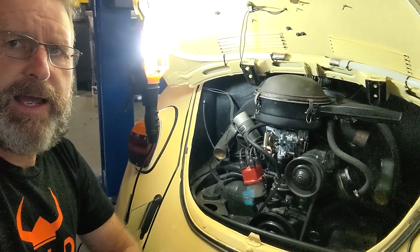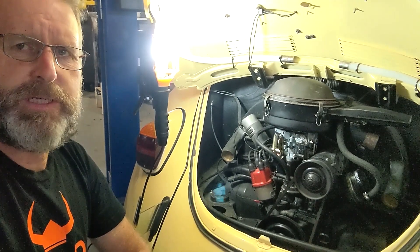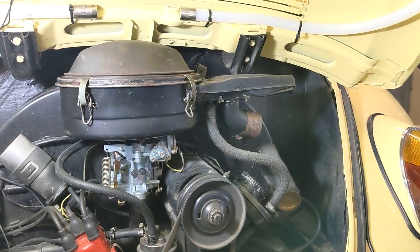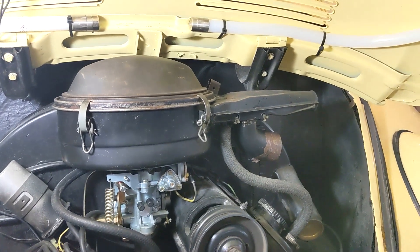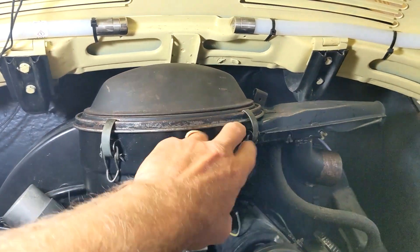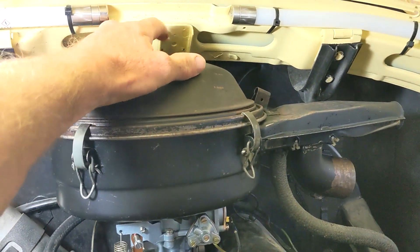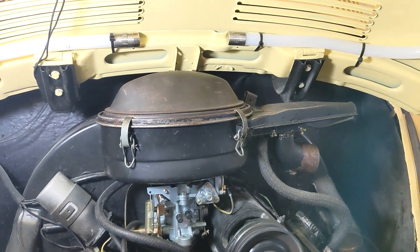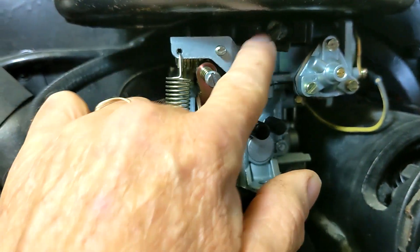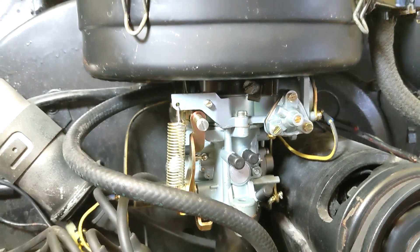It's an exact replacement for the original carby. So I'll put the oil-filled filter back on and talk a little bit about that filter design and why I've gone back to it. This filter is actually an oil-filled filter. Originally I tried just taking the top off and I couldn't do that — getting to those rear clips, there are two clips on the rear as well — it was near impossible, and the hinge area or spring setup didn't allow me to take it off. The irony is, up under here there is one screw — remove that one screw and the whole filter lifts off.